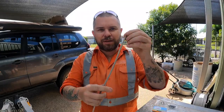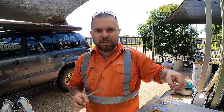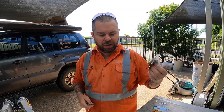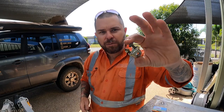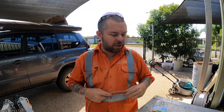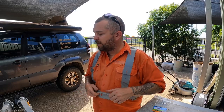For the handbrake I've got just enough of this laminated cable that came in the kit from Swift Coat Trailers, where the axles and everything are from. I've got a couple of these stainless little guides, so hopefully I can drill and tap them inside the chassis and it'll just keep the slack of the cable up. Hopefully I don't need two on each side because these were like $12 each. I've got these little cable clamps — you loop that through the lever on the back of the drum brake, double it over and clamp it. So it should be pretty straightforward. Hardest bit's going to be drill and tapping the holes to fit the guides.